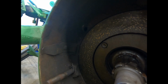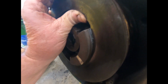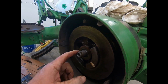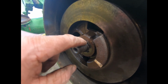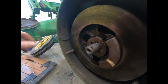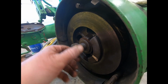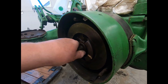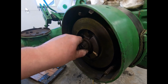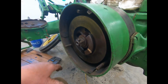As you can see, I've got one disc there that I've washed up and I've got set in there. That should stay right there. And this, I don't know if I can do this one-handed or not, but we're going to try it. Come on. That goes on. This is just like the other first reduction gear. You always want to make sure that you've got a lot of room here before you get to the shoulder of this shaft. Because if you don't, you'll be in trouble, and you'll end up thinking it's tight and it won't be. We may have to make another wider washer for this also. Yeah, that's gonna go on a ways. I don't know, we'll walk it up.